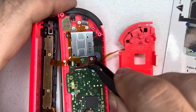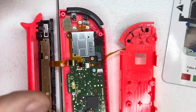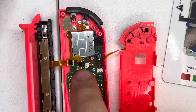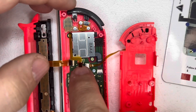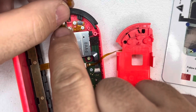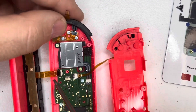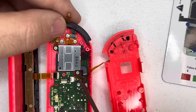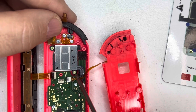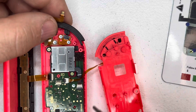This little connector is going to be straight up and down. When it's like that, take a pair of tweezers, grab that little cable, and get it out of the way. This only happens on the left Joy-Con because the right Joy-Con is easier. Hold that little cable back and it's going to reveal the two screws that attach the analog thumbstick.